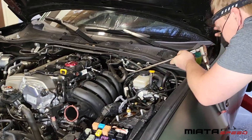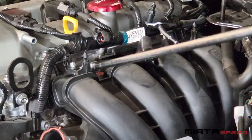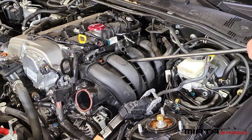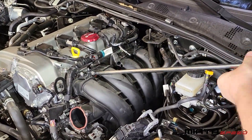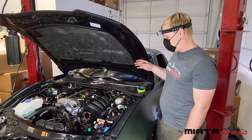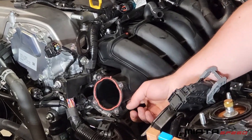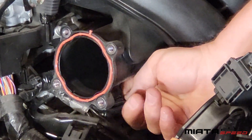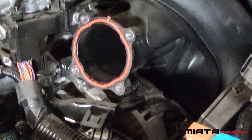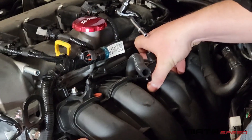Use a nice long extension to help with the one in the back. We've got all the bolts loose. You'll notice at this point that there are a lot of clips just clipped into it in various places. There's not a lot you can do about these. A couple of them, like the one just about the alternator, you can get kind of close to, but you pretty much have to just break them off. I've never been successful in getting them off nicely. There's one on the front and a couple underneath.